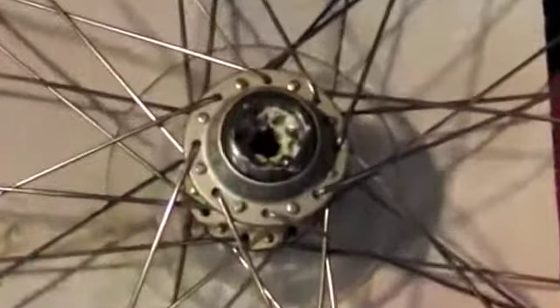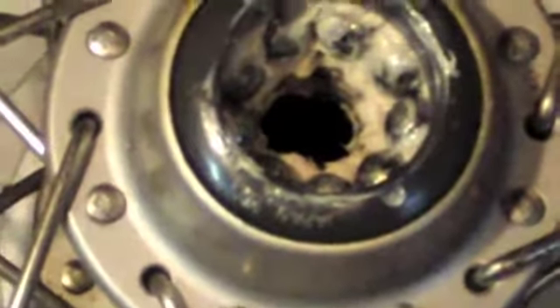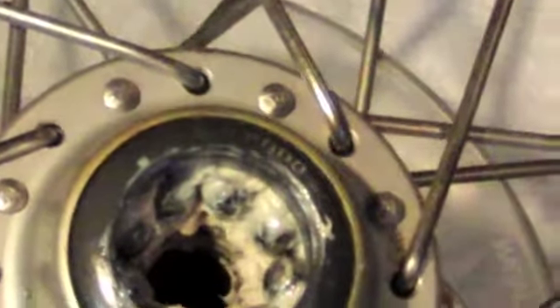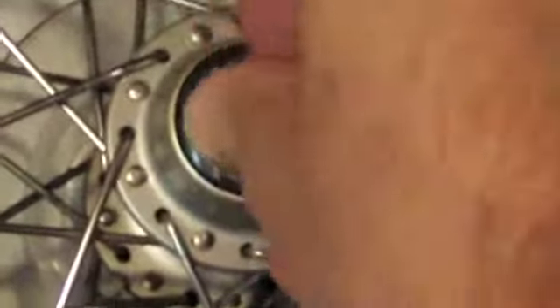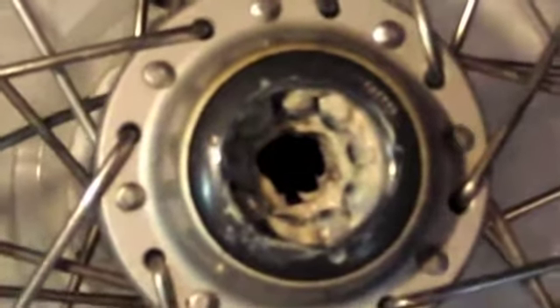So here are the bearings. What I did was use my finger to glob some grease in there — you can see it's kind of a white Teflon-type grease. Once I got enough in there I just stuck the bearings in by hand. It's a little bit tedious, so I won't bore you with that. Some will fall all the way through, so make sure you have something clean on the backside to catch them. Then I take the cone and just put it in there — turn it around, make sure that feels right. That's a lot smoother than it was. Check for any gaps — looks like I've got enough ball bearings. You don't want to go one short. They're all right side by side with not much clearance, all covered with grease.